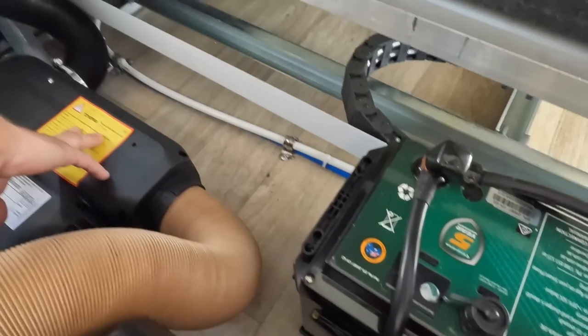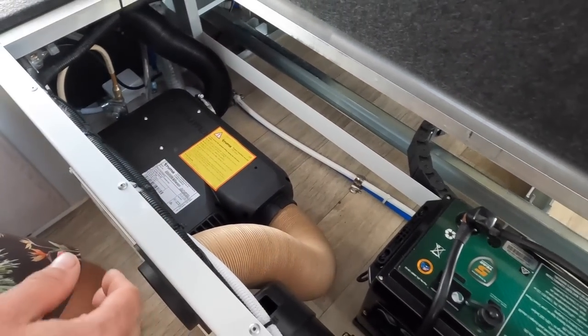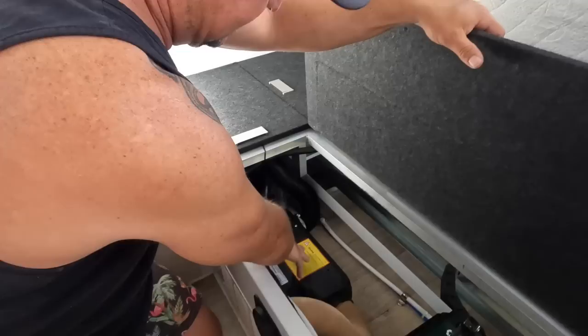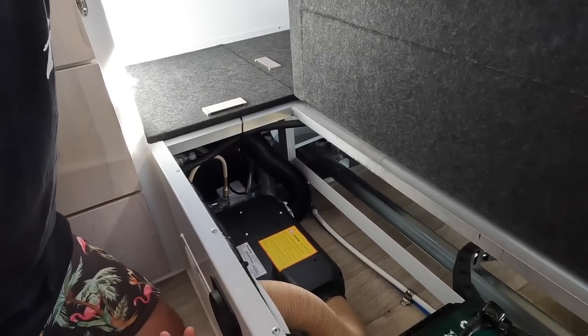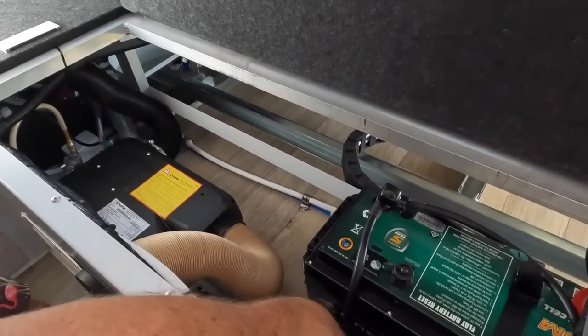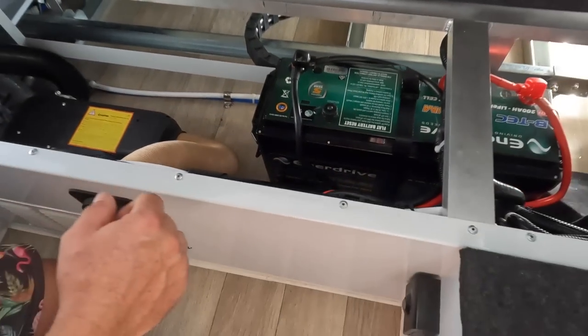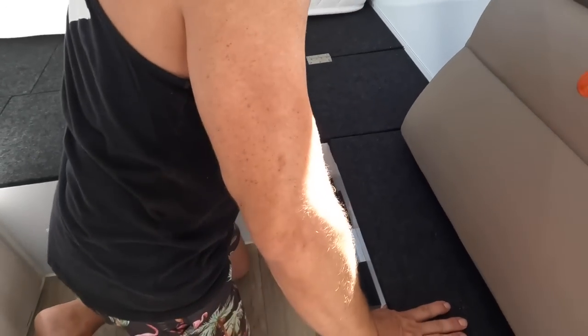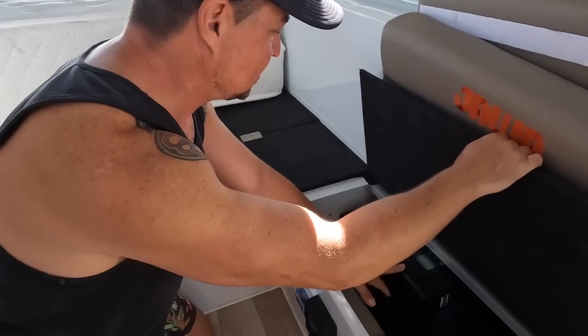We've also got the inside unit, or the Truma Vario heater. It's a bit hot for a heater right now, but that's neatly packed in here. It's vented out to the side of the van, you would have seen on my walk around, and it comes out here pushing nice warm air when it's cold. 2000 watt inverter, it's pretty straightforward, and I'll show you where the inverter controls are in a second. And then you've also got over this side your battery charger and your DC-DC.